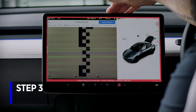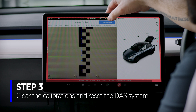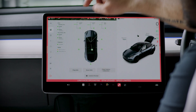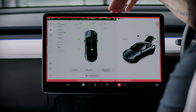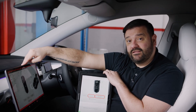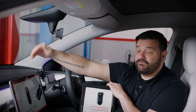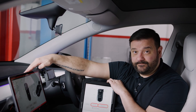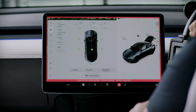To make an adjustment it's quite simple. First clear the calibrations, then reset the DAS system and clear the camera calibration before making the adjustment. There is a small adjustment screw behind the mirror — drop the mirror off, grab the adjustment screw and adjust it until it comes within tolerance, then put everything back together.